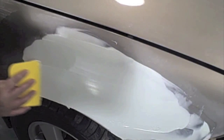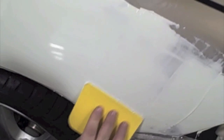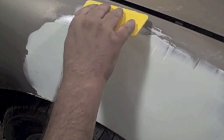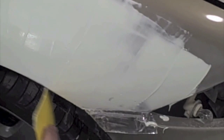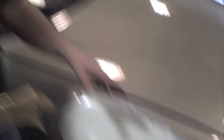I do want to cover the entire surface. If you have a spot where you missed and didn't get putty in a certain area, it makes it much more difficult when you're sanding because you have to feather that entire uncovered area. So make sure everything is covered. Also when applying, make sure you don't get trash in it — if you do, get it out, because you don't want drag marks from trash. That's just going to cause a lot more work when you go to sand. I use a new spreader on these final coats to avoid those marks. If you drag a piece of trash down the whole area you'll have to sand down to the bottom of it. Here I'm also feathering in the edges of the putty, which will really reduce the amount of sanding I have to do to feather the edges in.